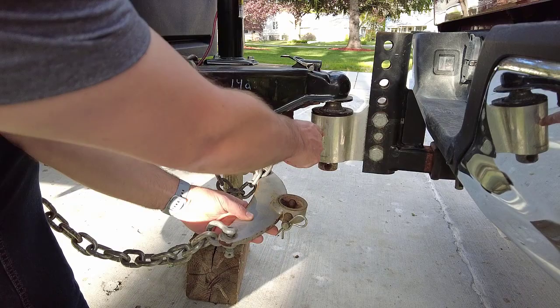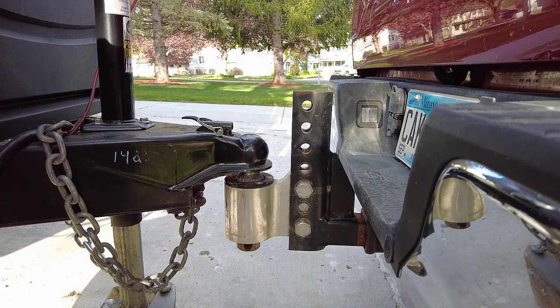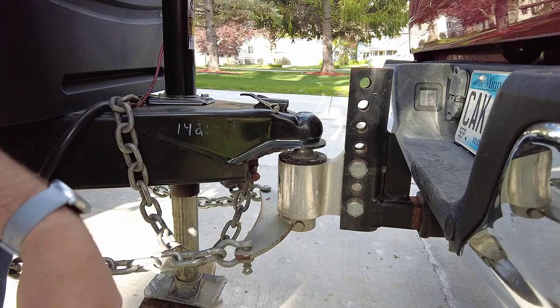Step three: we're going to install what's called the tension plate onto the bottom of the ball mount. This is how it comes — it's pretty much attached to the frame of the rig and I just leave it attached at all times. When you're at your site, I just set it off to the side. To attach this, you take this pin out — there are two holes at the bottom of the ball mount — and you just line the holes of the tension plate up with that and insert the pin. Don't forget the safety clip on the other side of the pin.